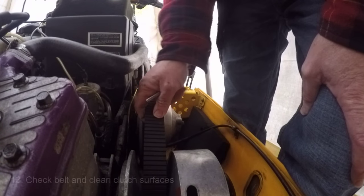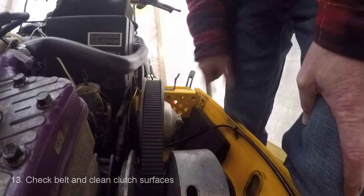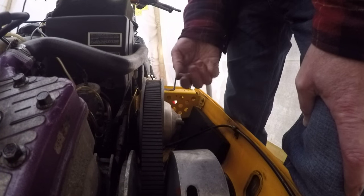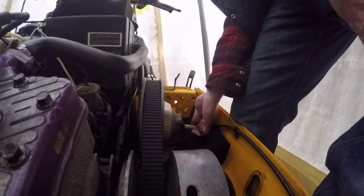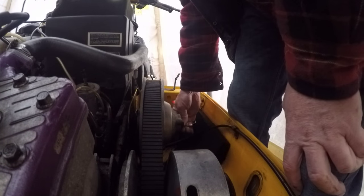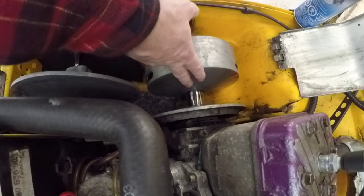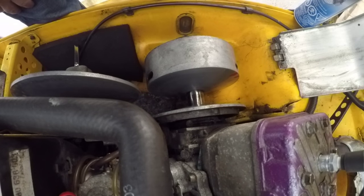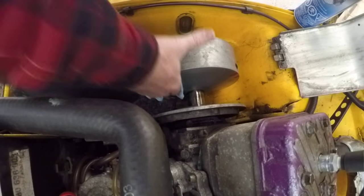With the drive cover off, we're going to inspect the belt for wear and damage. We'll take this belt off so we can have a better look at it and clean the inside of the drive pulley and driven pulley. If you've never done that before, you need a tool that looks like this — it's a small threaded tool that fits in there, and as you thread it in it pushes against the other side to spread the pulley just enough to get the belt off. Once the belt is off, clean the inside surfaces of your primary and secondary clutch using something like brake cleaner or lacquer thinner — something that won't leave residue that could make your belt slip.